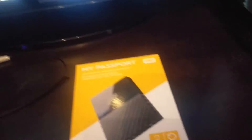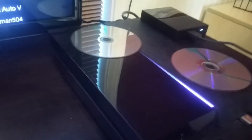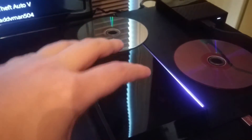The reason why I kept mine external is because you can go back and forth. You can take your games and put them on there, and I can take my external hard drive to the PS4 Pro if I want to. I can take it to my neighbor's PlayStation. As long as you have your user ID — which is your password and your email address — you can take your external hard drive anywhere you want to. If you internally install your hard drive, it is fingerprinted to this PlayStation.